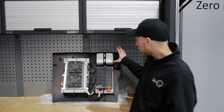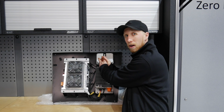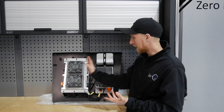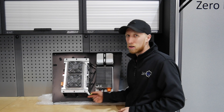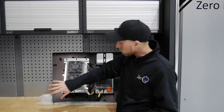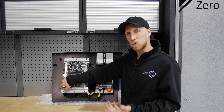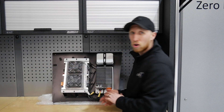Josh has fitted a small junction box that we're going to wire both of these into, with fuses inside, and then we're going to take dual 35mm cables from here to the battery pack. That just neatens everything up so we're not running individual cable sets for each unit. We're also going to have the 12-volt output coming out of here to link into the 12-volt battery, which is in the boot on the MX-5, thankfully. We also have AC input here, and where the fuel cap was originally located is where we're going to put our Type 2 charger port, which comes straight into here.